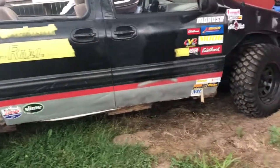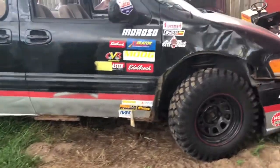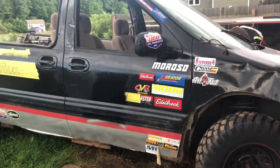The GT45 did work pretty good, but it definitely spooled slow. So, just initial thoughts on the 7875 street driving. It spools up about 1,500 RPMs quicker. What that can get you is foot braking with about a 1,500 stall stock converter. I can spool to 1.5 pounds of boost, whereas with the GT45, all it did was push through the brakes. To those saying RIP 3.4, I will say they run awful longer than most motors run.